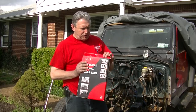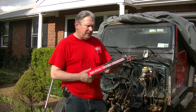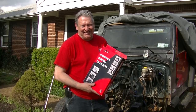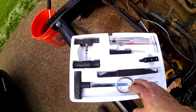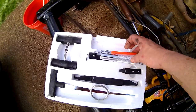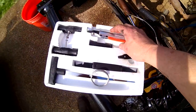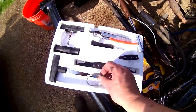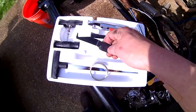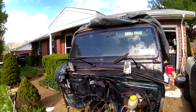This is my Super Duty tool kit that I got off of eBay, and let's take a look at what I got in it for like $20 — I don't think it's a snap-on. So this is what comes in the kit, and for the most part we should be able to get the windshield out with the pull knife here. That's one of the most common tools you use to remove a windshield. There's also piano wire you can use to cut it, a urethane blade, and a hook. Let's get started.